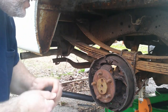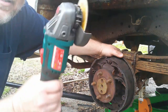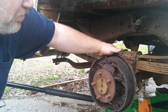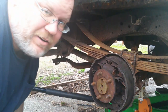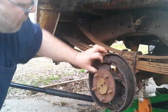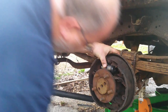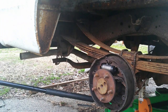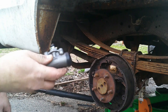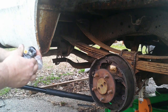These are absolutely shot. If the line is stuck on there good and just not going to come off, just cut it off — it probably won't hurt to replace the line anyway. It also probably would have helped if I had taken the line off with the bolts, but I'll just cut it off and put a new line on — not a big deal. Wrong wheel cylinder, so that'll shut me down for the night. I did find it ironic that these were the same ones Ford used — 71 F100 — I'll end up using these wheel cylinders once I find the other one.